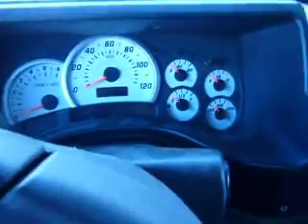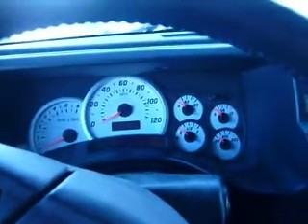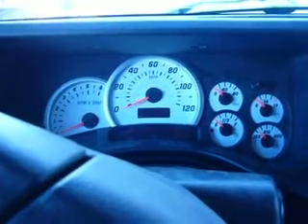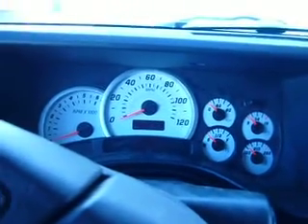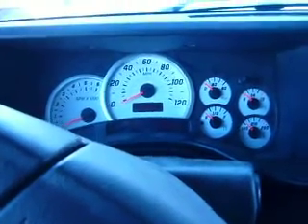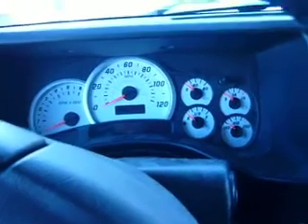I wanted to give you a quick update on the Hummer. We're out here freezing — look at the snow, it's cold up here today. Here's the Hummer. I haven't put the key in yet, but I have solved the stalling and rough idling issue. I think it was the throttle body control module — I had it removed and cleaned properly, put back in, and that seems to have solved it.